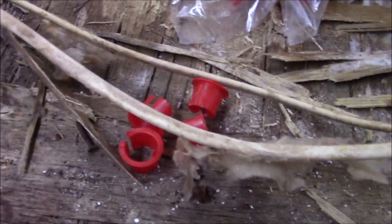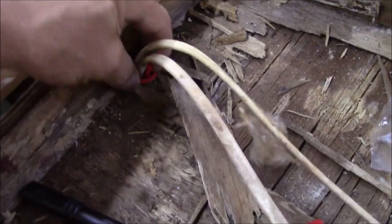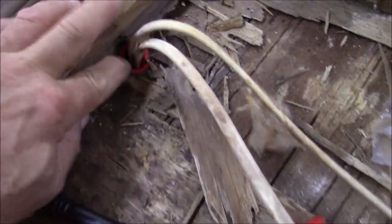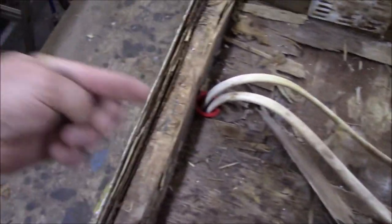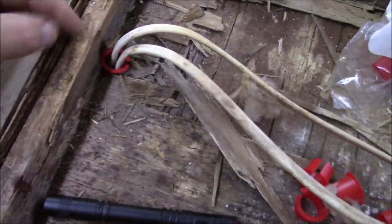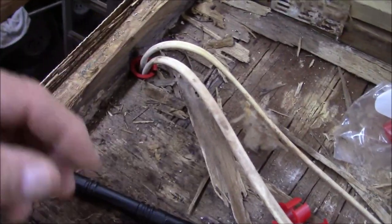So down inside there, see if I can get a flashlight to show you. There's a metal ferrule down there, and sometimes it'll compromise this wire, and we want to protect that. So all it is, when I say they won't put one more red cent into your coach, well, here it is. So we put these in here to protect it from that ferrule. The ferrule is just a piece of pipe, so when you put a screw coming through this side here for the gutter, you don't put it through the wire. That's pretty smart.